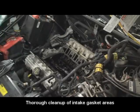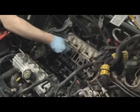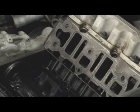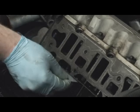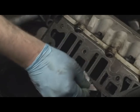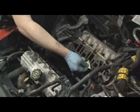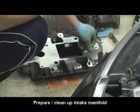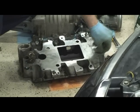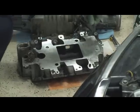Using a tilted knife because it's stronger than a razor blade and triangular gets in the hard to reach spots. You try to do it from top to bottom so you're not pushing dirt into the intake manifold or into the lifter valley. Throwing dirt towards the injector holes and stuff. This is aluminum, so you have to be a little more careful with it.